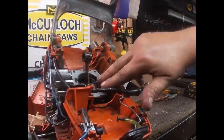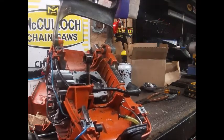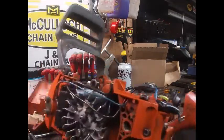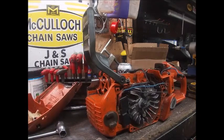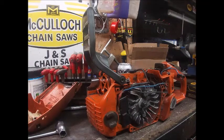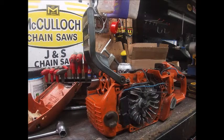Hopefully you can see this pan — you can even see where I've decked it. I gotta get the glue back off of it. It's about that thick — that's what you've got to use to put a 350 or 346 style top end on it. What I'm going to have to do is — the 346 cylinder has to feed off of the case — so we've got to cut a little channel into this thing just so it can get a pulse for the impulse line for the carburetor. I'll probably wait and do that at the very end, but it's just something that's gotta be done.